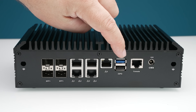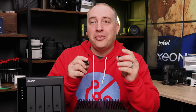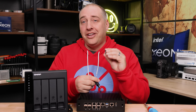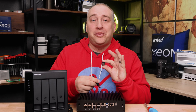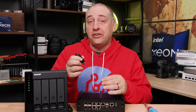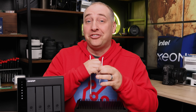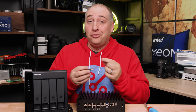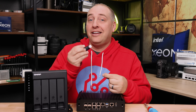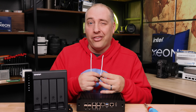Next to this, we have USB ports — a USB 2 port and a USB 3 port; you can see one is blue and one is black. To set this up, we used a little wireless keyboard and a Ventoy drive. The original thought was to put the wireless receiver in the USB 2 port and the USB 3 key with Ventoy in the USB 3 port — but the wireless keyboard and mouse just did not work. We flipped them, putting the wireless controller in the USB 3 port and the SanDisk in the USB 2 port, and everything worked fine.